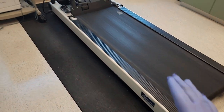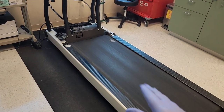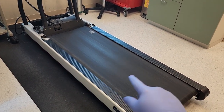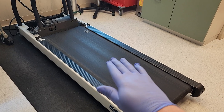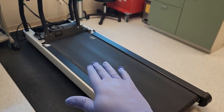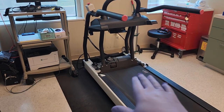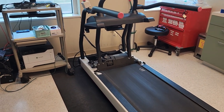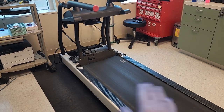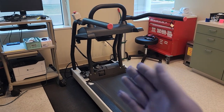This is a Midmark unit, and one of the things most treadmills need is periodic maintenance — the belt has to be lubricated. There's a hard board underneath the belt and that hard board needs to slip and slide easily with the belt. A lot of people have commented on my other videos that GE units don't need to be lubricated, but I still disagree because I've seen where the hard board actually gets wear and tear. Regular cleaning and lubrication is still a factor.